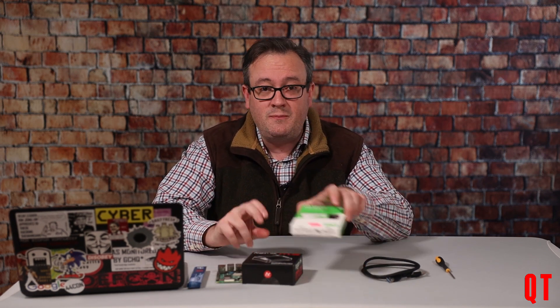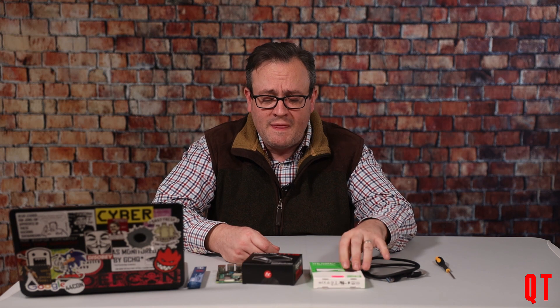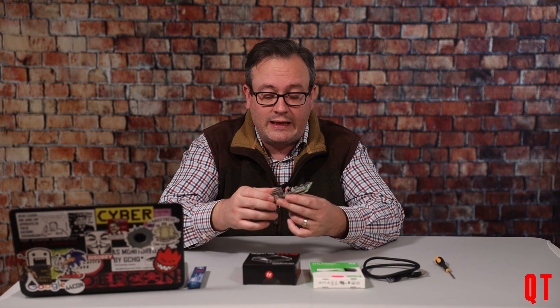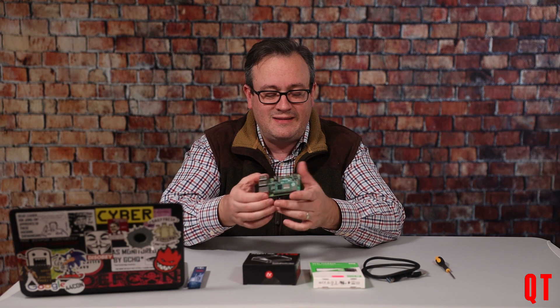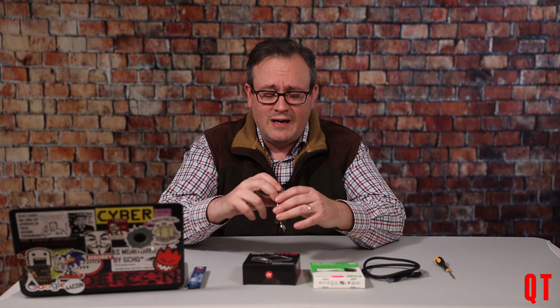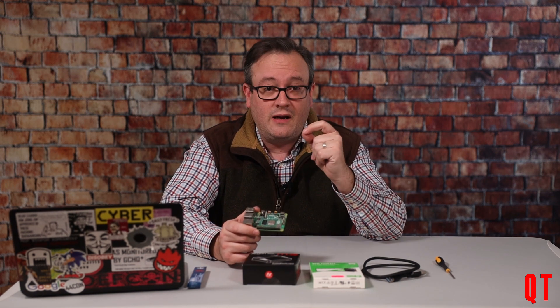So what's the solution? The solution is to boot off some kind of solid-state disk — in this case, we're going to be booting off an M.2 drive. In the past I built these things, and you end up with a Raspberry Pi with some kind of heatsink device, and basically just connecting your hard drive off the back of the USB. It looks a little bit rubbish. You've got to have a power supply for the hard drive, a power supply for the Raspberry Pi, and it all just looks a bit Heath Robinson. I like them to look tidy and purposeful.